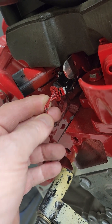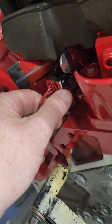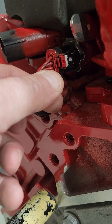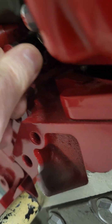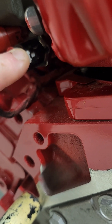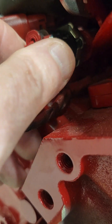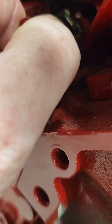You're only going to have three color-coded wires here. Now here's another thing about this connector — there's a white lock tab. If you push that tab in and lock it into the connector, it might be painted over or it might be red. You're going to have to pull that connector out — reach over there and snap it out. Once it's snapped out, you need to squeeze in on the outside of the connector, push it in, and then it'll come out. If you don't push it in, it won't come out.